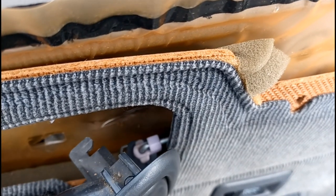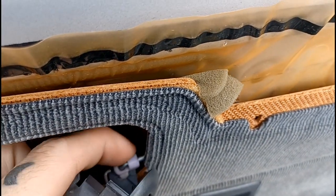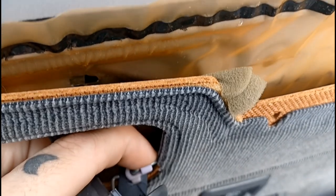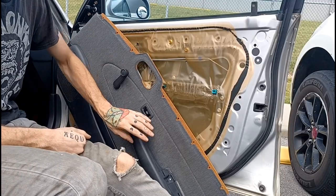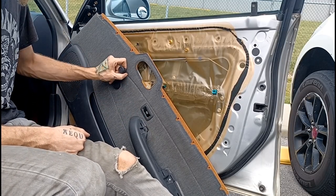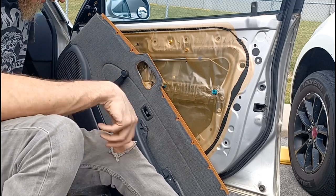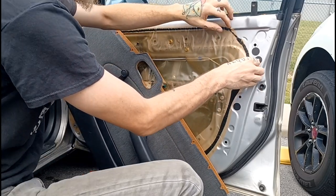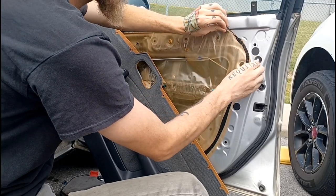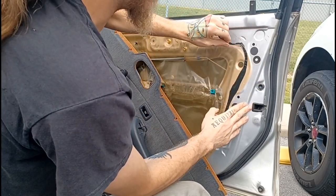There's a little rod and a clip in there. I'm going to set the camera down so I don't break it, and just get that rod off of that clip. You can remove the whole thing if you want by taking the window crank off. For now I'm going to see if I can just fit in like this. You want to peel this water shield back out of the way - trying not to tear it, we do want to try to get it back on.